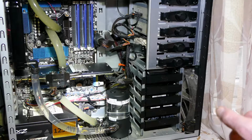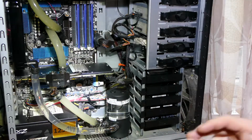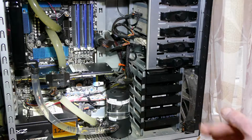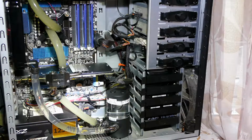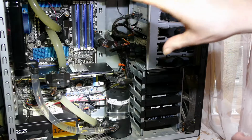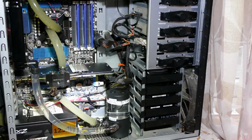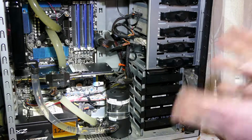Now the separate power supply could be an additional power supply, just a spare one for your computer. It could be an adapted one. It could be just a temporary wired up plug. It's up to you. But run it separate from the computer for about half an hour. Not even half an hour, 20 minutes. And once you've established that there are no leaks present when the system is starting up, that also helps you fill the system. Then you won't have any leaks at that temperature.